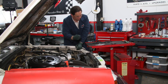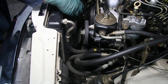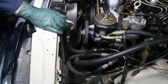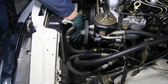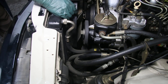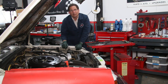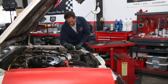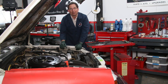Now I'm looking down at the front crank seal. Here's the front crank seal — that's another real common leak area in these older high-mileage diesels. You'll see this right away by looking down along the front of the engine; you can look off to the side at the frame rails and they'll be wet with oil. That's because the counterbalance and crank is flinging the oil out of the seal. If it's really bad, you're going to see oil slung up on both sides in direct line with the front of the engine block.